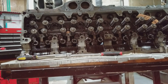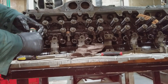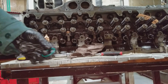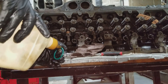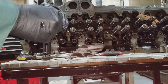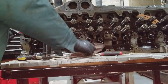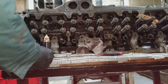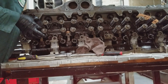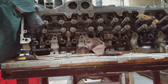We're taking the J33880-4 and installing a new cup onto it. I'm going to take the new o-ring and lubricate it. The instructions tell you to use petroleum jelly; I'm just using engine oil. Petroleum jelly would probably help a little bit better because it would hold the o-ring onto the cup while you're inserting it, but I wasn't having a problem using engine oil.